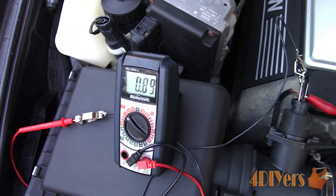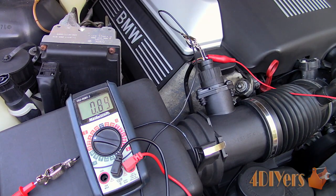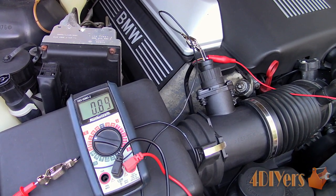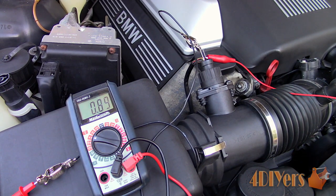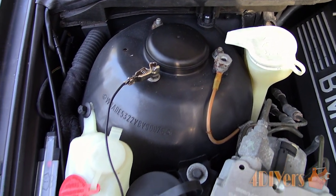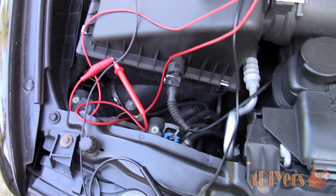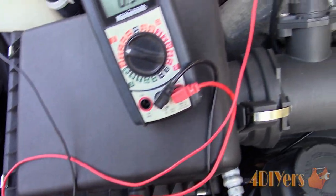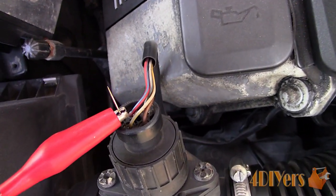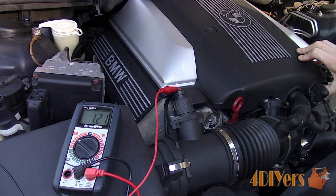The value will change based on the engine's RPM. The sensor uses a 5-volt supply. At idle the lowest reading was about 0.88 volts, and as the engine RPM increases, so does the value. If the reading is excessively high at idle, then there is a fault with the sensor. If the reading is lower, again there might be a fault with the sensor, the air filter is dirty, or the intake track might be plugged with debris. At 3500 RPM the reading is 1.99 volts. If you are noticing any flat spots, not a smooth linear increase, or the value won't increase, then there is a fault with the mass airflow sensor. At redline the sensor should go out to a full 5 volts. You can also do a test by probing only the grey wire with yellow stripe, then grounding out the other probe — I used the strut brace bolt as a ground point — and as you can see we can still achieve the same accurate readings.